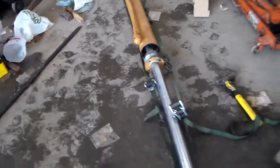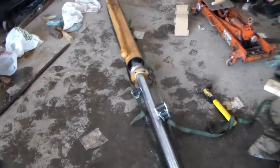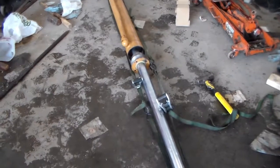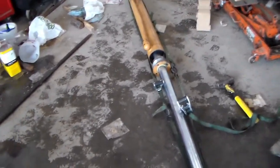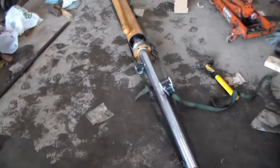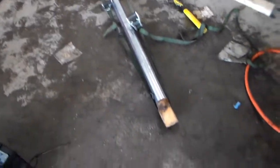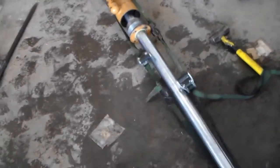I've been working on the backhoe cylinder. It was really tight getting it out — I ended up pulling it apart with the tractor, chaining it to my dump truck. Found out the piston seals were all swollen up, so it was wedged in there really tight. I wanted to give you a quick shot of how I'm getting it back together.